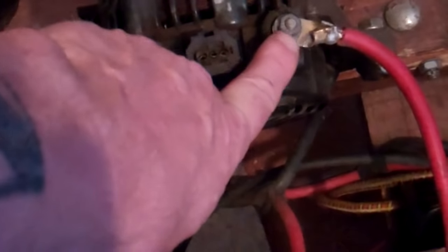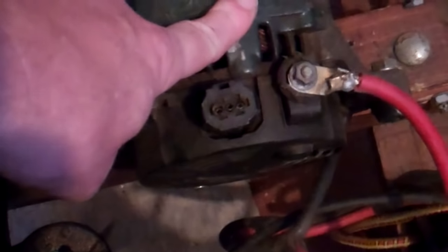This one came off an old Ford Fiesta — it only needs the positive connecting to this terminal and a negative earth. I've never touched these other terminals at all. I know one goes to the charge light but that doesn't worry me — I've got an amp meter on the front so I can see if I'm producing charge.